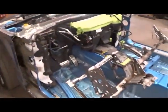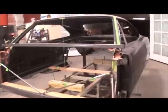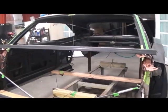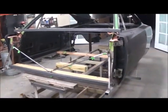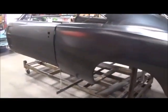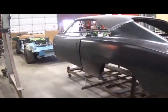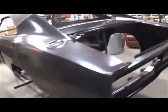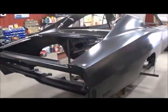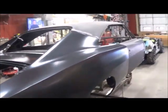There's a few little finishing things to do here and there. I've got this ready to go other than I'm fixing to put this bar in - I'm going to tack weld it in there because I've got to take all the rest of this out and then set it on there. I'm going to try to set these rails on the rockers in this car and make a little track or a landing for it - then it'll be nice and solid. I've got the back just mocked up, but it's all ground and cut enough to where it all goes together pretty good. I'm fixing to take it back off and see my first setup.